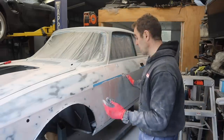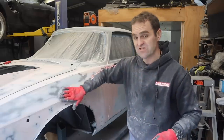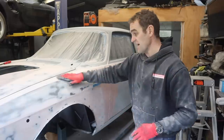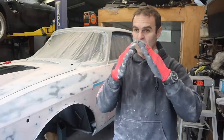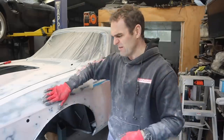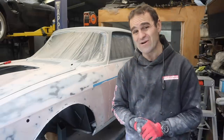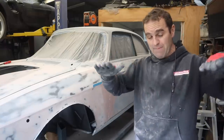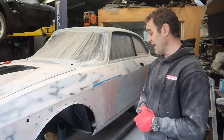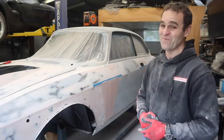The tape method has been working really well - going backwards and forwards, laying the tape on, getting the edges right, looking down the side of the car. I've now got a nice crisp edge all the way along the sides of the car and the same on the top edge. When the final paint's done it won't be quite that crisp - I can knock that down later at the high-fill stage - but I want to make sure it's crisp now. Anyway, that's three whole days of work and it's still not done. The boot's not on yet - still going to do around the boot and get that perfectly level.